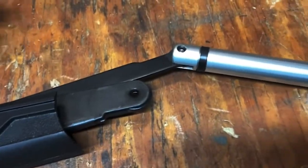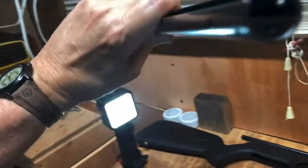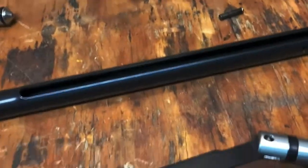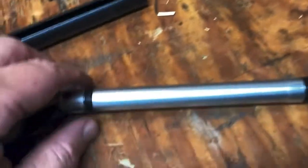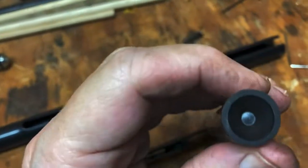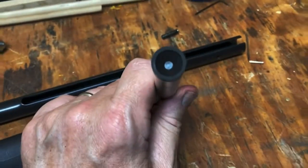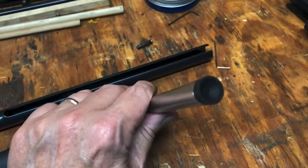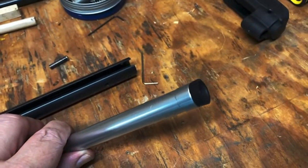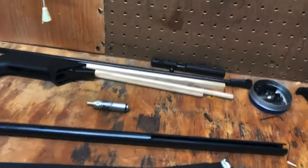I will install this into the air tube, which is nice and clean. I had to clean that out — it wasn't too bad, but it was oily. I also cleaned off the piston and put a new suction cup on. It had a little wear and tear, not much. It could have been used a little bit longer, but since I've already got it apart, I thought I might as well put a new one in. I'm going to put this in, and when I get it in, we'll do a quick test.